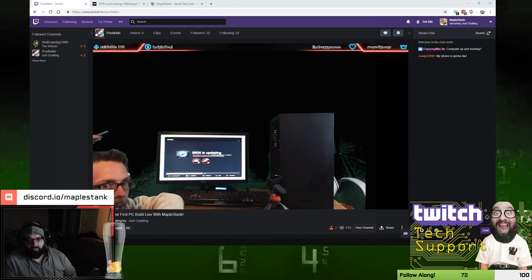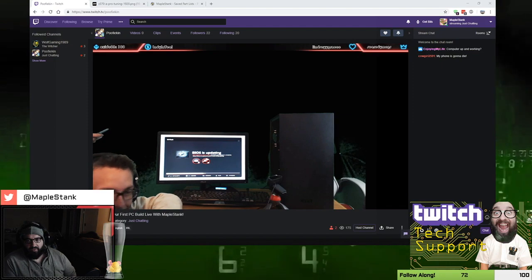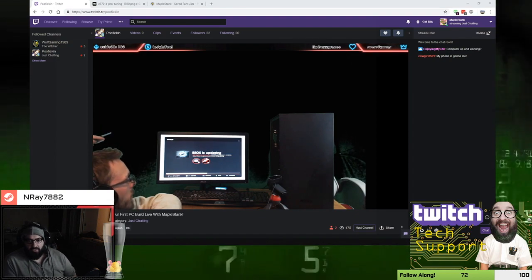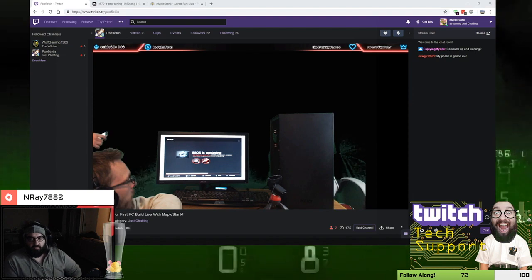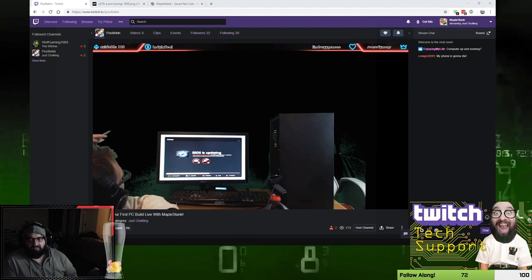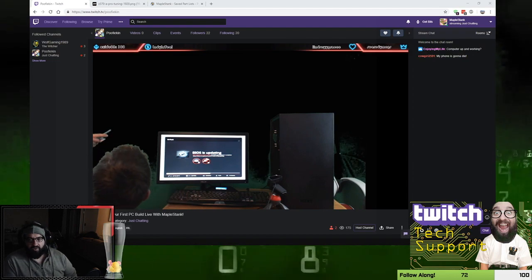So guys, for anybody who's curious, what Kody did was he basically got the file that I gave him with the BIOS update, put that file on the USB drive on his own computer, and then took the USB drive, plugged it into Poofie's, and now there's a utility in the BIOS that reads that file, and that's what you're seeing on the screen right now.